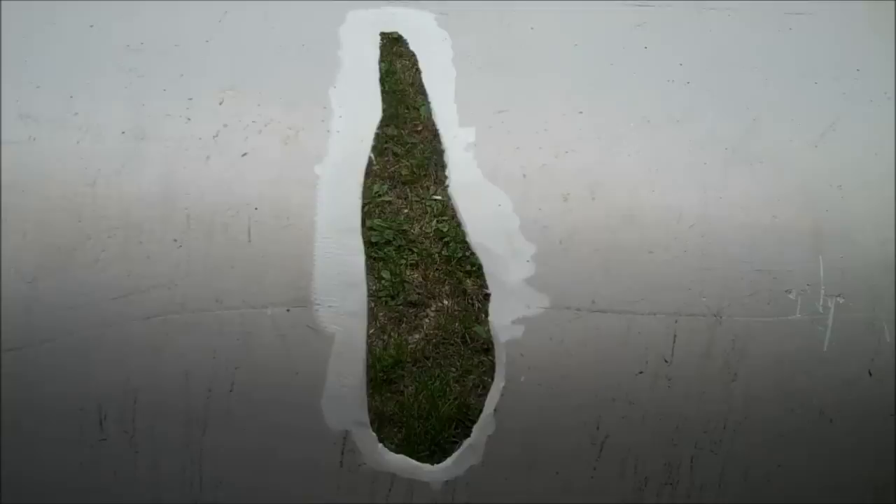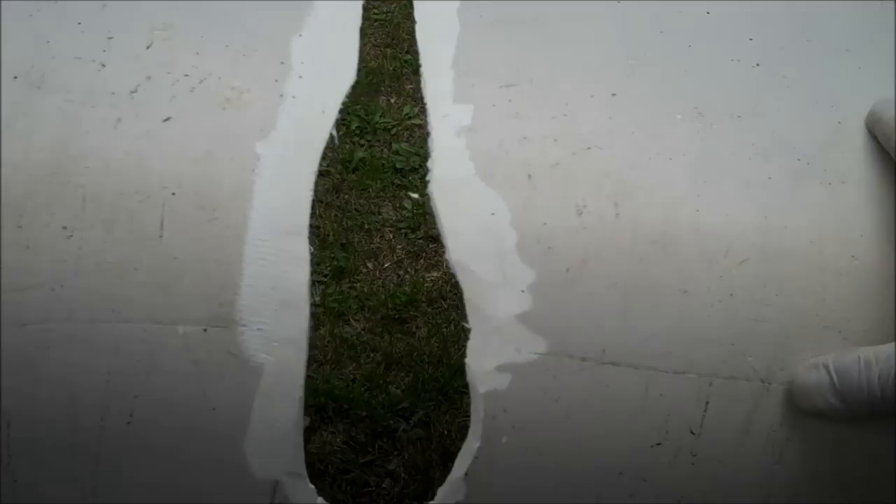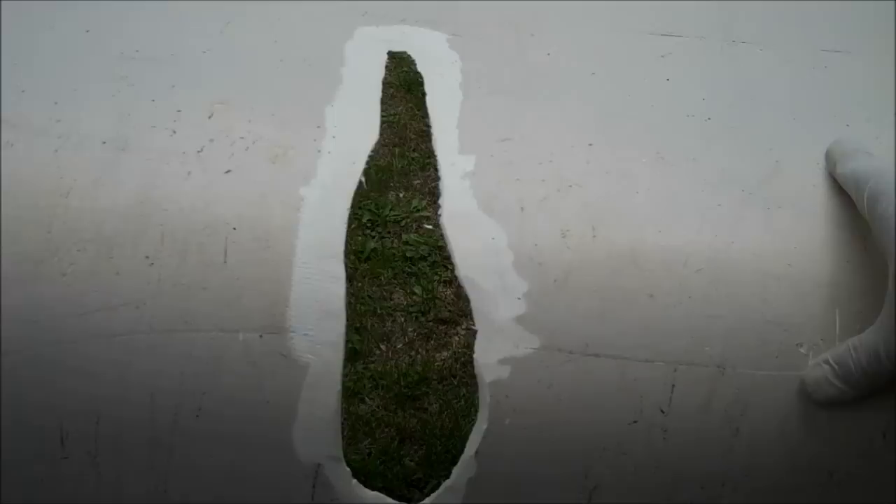I wanted to show you that once you start cutting in here you can see there's more damage from that impact, and you may run into that. The crack is going to get bigger and scarier sometimes while you're repairing. When I'm done it appears that I have more damage and a bigger hole than what I started with. But really I'm getting rid of any of the weakened fiberglass that was around what we could just see on the surface — the crack itself. I'd rather bite into it more than I have to, just to get rid of any weaknesses, and then go back and repair it. In the end, it may seem worse than when you started, but that's the correct way to do it.